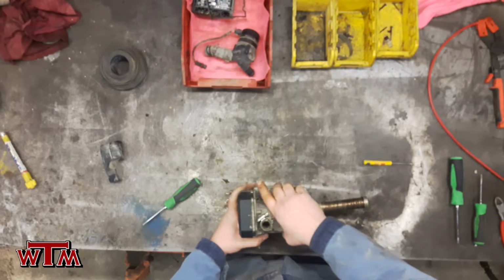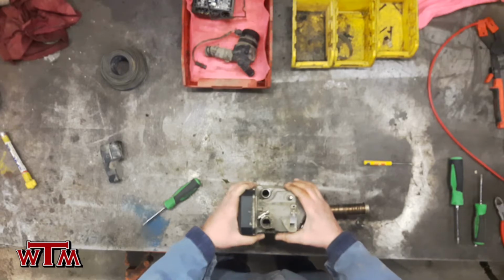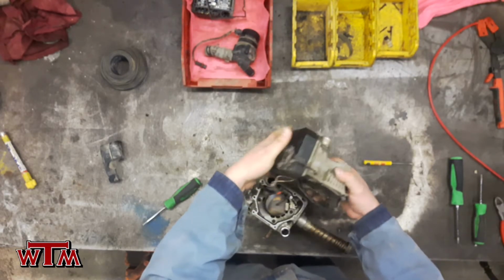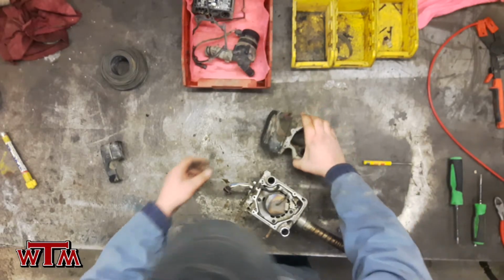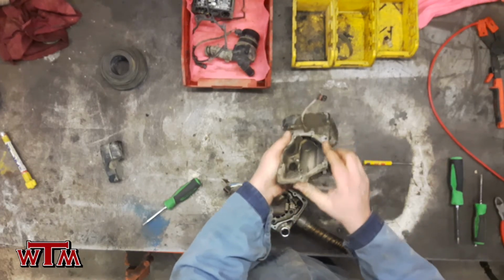And now we're going to separate our combustion air chamber and pull the fuel line out. Just be careful pulling the fuel line out, not to get too much stuff in it. It's just held in by a grommet. We'll have our gasket inside there. We're going to remove that for reassembly. We're going to put that component to the side as well. Clean that all up.